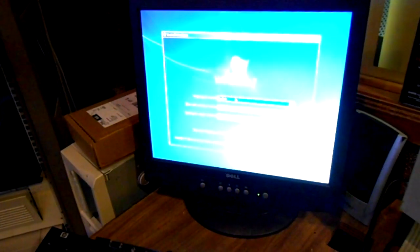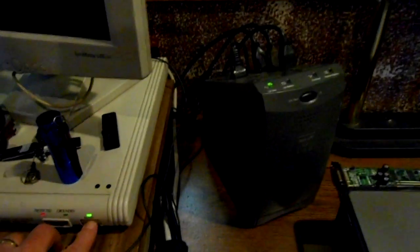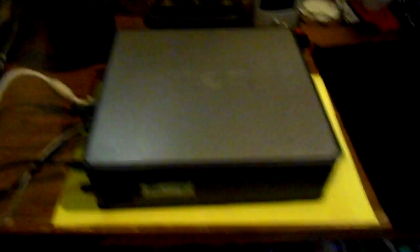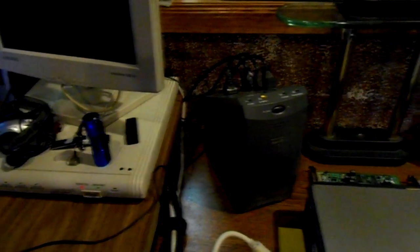What's currently plugged into this unit is this monitor, which is now installing Windows 7, and this small Dell. I'm going to go ahead and push this button right here, and you can see that the on-battery light has kicked on but everything is running quite normally — so there's no interruption at all in the power. That's how these battery backups work, and when it's just sitting idle they're monitoring their own batteries and charging them.